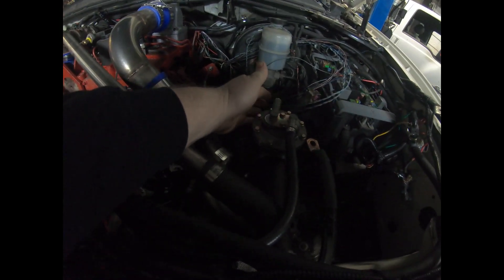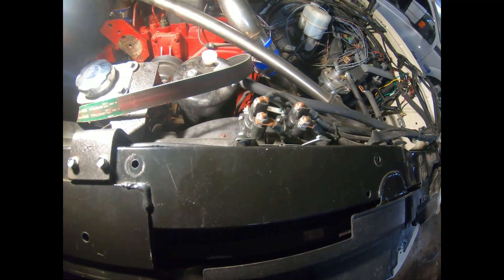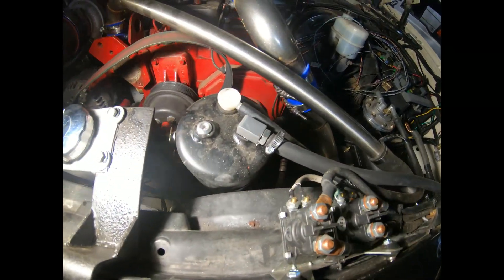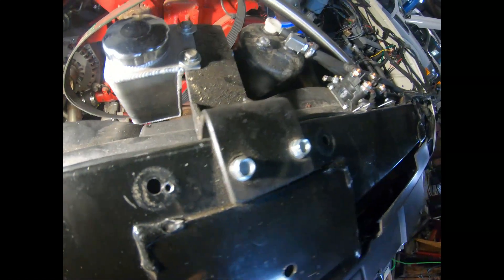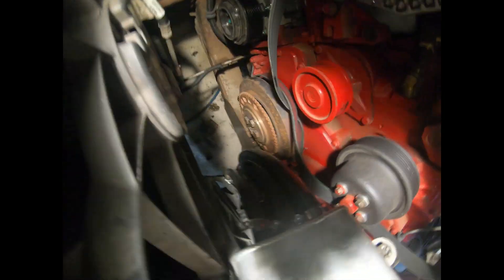We had to reroute this line down and around here. We have our vacuum pump — batteries are out of it right now because they're dead — so all this stuff is just kind of hanging here. We got our grid heater hooked up, and that's where I mounted the relays since there's not really any other place to put them. Got our vacuum reservoir right here — this black thing — it's hooked up. We ran the vacuum lines around the battery into the booster and to the pump. We also have our power steering reservoir mounted and filled up. I had to make a bracket off of this front cross member that goes down, and I also made a brace that goes down to the frame so it's nice and solid.